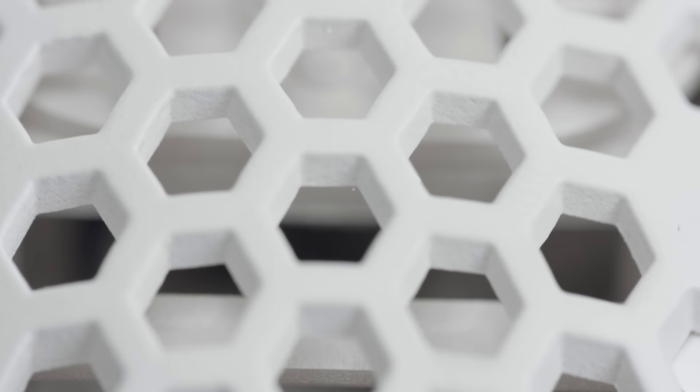The Ultralight 2 is made of this raw composite material for the shell, which is kind of like a light tan or ivory color. But I want to make it white. So I took the shell apart and applied two coats of satin bright white spray paint, letting it dry in between, using very light coats since the material is already pretty light. Then afterwards I applied a satin crystal clear finish to make it so it's not that sticky tacky finish you see with usual spray paint. In the end it's all white and doesn't stick to my fingers — it's a very smooth finish.